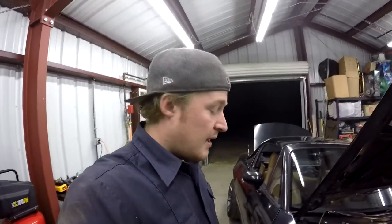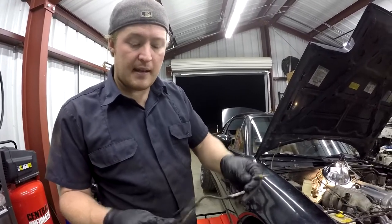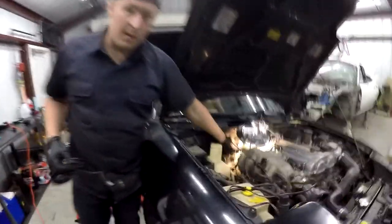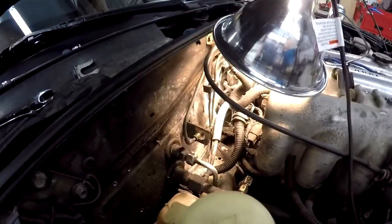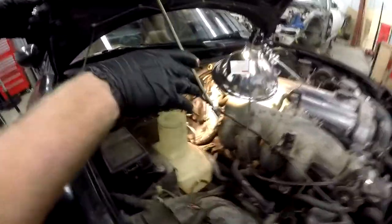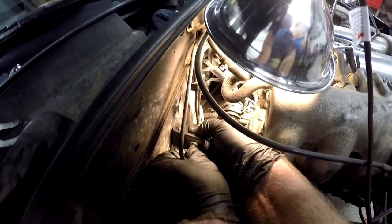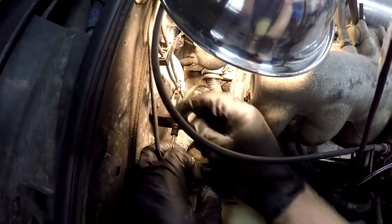I'm going to go ahead and get that last mount taken out, and then we can move on to putting the new one in. Once you reach back there and unscrew that piece from behind the head, if you already took the bottom piece out from above the slave cylinder, this will just fall right out. The top rubber part of the line is only held in with a clamp, so stick a pry bar down there and pop it off. Now that the old line is out, I've got my new stainless steel line ready to go in. Bring it over the side, point the end that goes to the slave cylinder downward, and push it into that general area. Then bring it back up and bolt it in, and slide the factory clip through.